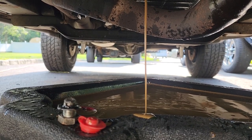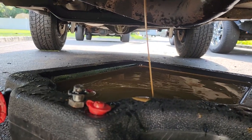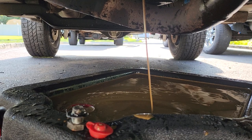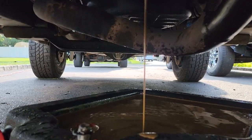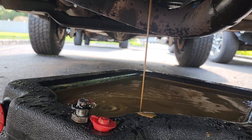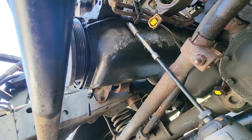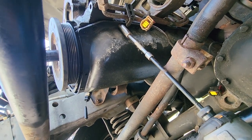It's not going to work — we've got to drop the oil pan, it's physically stuck. While dropping the oil pan I realized I never drained the oil, so I took off the drain plug and about two gallons of coolant just spewed out all over me — pure coolant. Then I got this frothy stuff — another couple gallons. It is just slimy, snotty coolant mixed with oil. We've got a whole vat of Jeep snot. Last oil pan bolt — I really hope it's empty, I do not want to get this Jeep mucus on me.